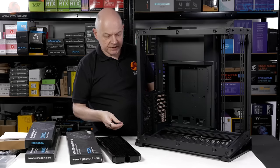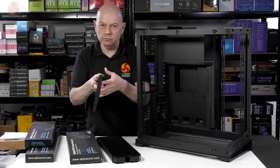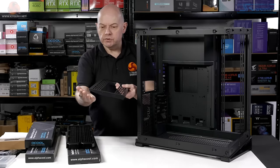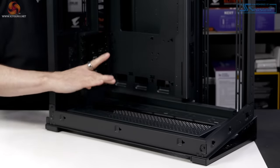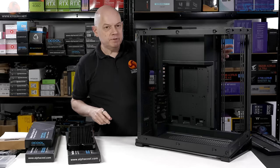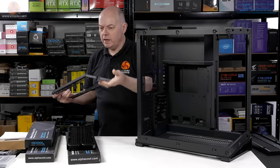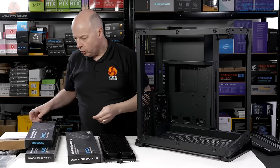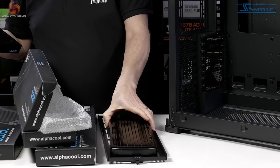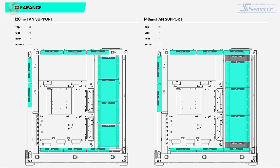In the floor of the case we can also install either a 360 or a 420. Single screw at the rear, out with the rack, which is mounted on rubber grommets to keep it quiet and stop it rattling. The 420 goes on without any difficulty. You can have this rack angled to match the floor of the case or horizontal to match your table. In the side position there's another removable fan rack — this accommodates either a 420 or a 480. The difference being a 420 is three 140mm fans; a 480 is four 120mm fans. That gives you 11 140mm fan capacity in this case, or 12 120s.